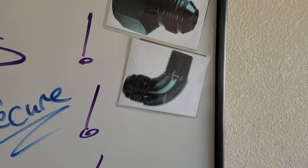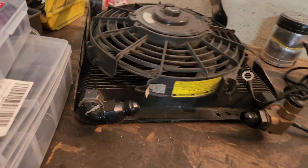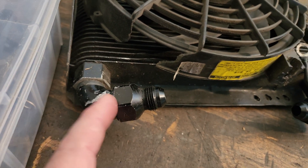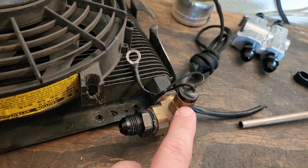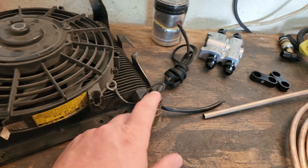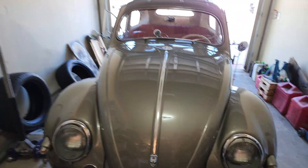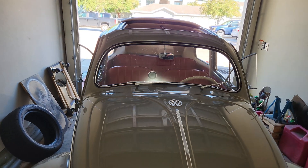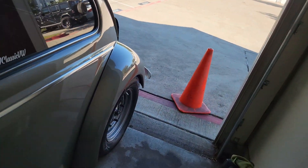Here's another example of a full-flow fitting right there. On my old oil cooler setup — that's a full flow right there, into a Dash 10 down to an 8 because it was a 10 AN that I found. I did use this hard 90 here because I wanted to install this sensor — this kicks the fan on at 180 degrees. I'm probably going to end up installing this back on Goose's setup so that I can hardwire the fan to the battery, so I don't have to wait with my key on in the ignition, waiting for the computer to tell the oil cooler to turn off.